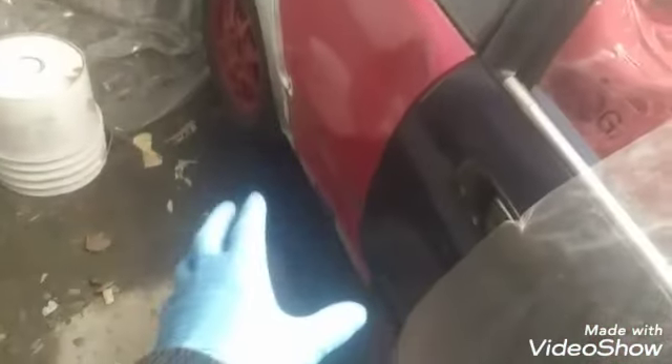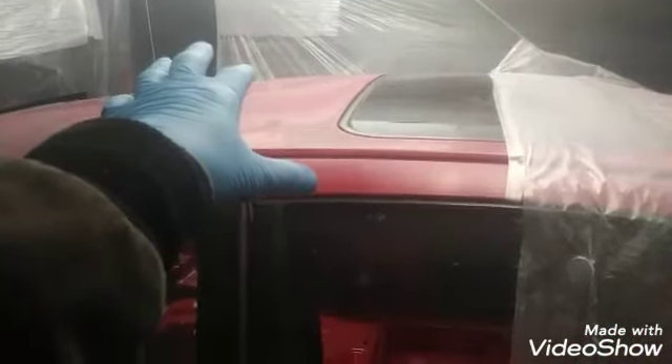She's coming out good, man. Right now I'm about to fill in the holes over there like I mentioned. Probably mesh that little piece — I could cut and replace it, I could get that filled. Some point tomorrow I'll sand it, get it close to prime, then prime seal and stuff like that. So that I could just start painting the quarter panels completely, and the top, which is the only thing that's going to get painted.